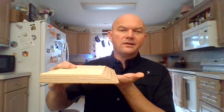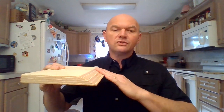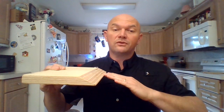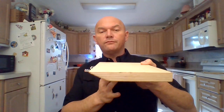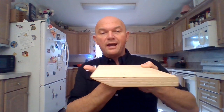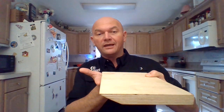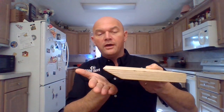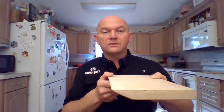If your slide floor sets on top of your interior floor and slides out, that 65-degree bevel gives you a nice, smooth transition for your customer when they step from that interior floor to that slide floor, so that they don't catch their toe and trip as they're stepping out into the slide-out. The other application is when this floor recesses to be flush with the interior floor — there's a track that it drops into that meshes well. That 65-degree bevel lays perfectly against that interior floor, giving you a flush floor from the interior to the slide-out as well.